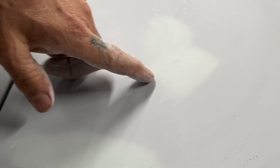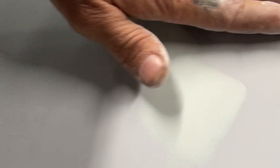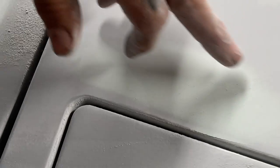This is feathered off on this side. That's not feathered off on that side because you can see that hard ledge. But I can see a soft edge going this area where it's feathered on that side. So when I'm rubbing over here, I have to make sure I'm trying to get on this side more than this side. It's got a hard ledge going over here. It's kind of feathered off over here. So you really have to pay attention to what's going on. Hold it flat.